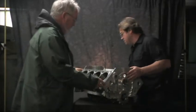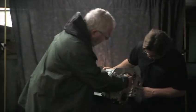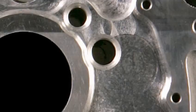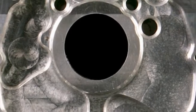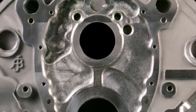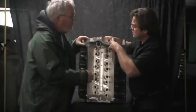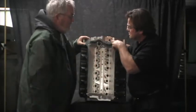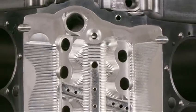Well, where do we start with that? The front will do. This is the main oil galley, put in and back — it's a dry sump system. The oil goes in here; that's a dash-10AN fitting, and that goes right into the main oil galley.